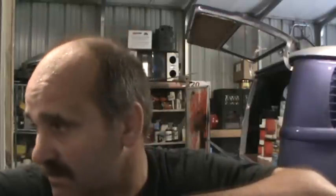So that's why they made Bondo have the ability to stick to these primers and to the epoxies. A lot of body shops won't even put plastic over bare steel. They go right over epoxy. They'll epoxy the whole car, etch it, epoxy it, rough up the affected areas where they're going to do their body work, and then add their filler. All the cheaper fillers have to go over bare steel. You can't put cheap filler over epoxy, like the Dynolite, the Chromolite. That will not go over a painted surface. It won't adhere. It will come loose.